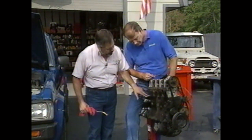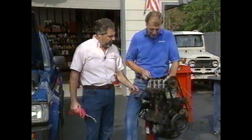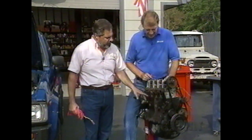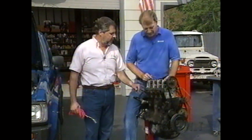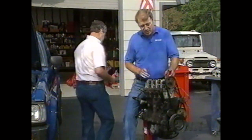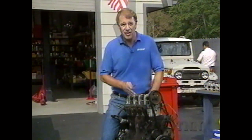This makes it even more important to have good valve seals. Here we've got four exhaust ports and in these exhaust ports we should have nothing but exhaust carbon. But look at number three — it's loaded with oil. This cylinder is pumping oil, which is probably why this engine was taken out. Most likely when you've got one cylinder pumping oil, you don't have all the rings bad — you probably have a bad valve stem oil seal. These overhead cam engines run at high revs, generate a lot of heat and power, and the valve seal tends to be the weakest link.